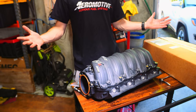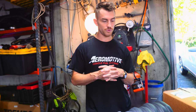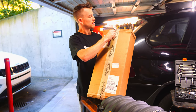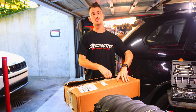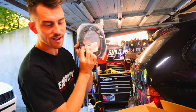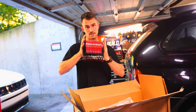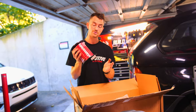I went ahead and went with the FAST mid-length high-horsepower intake runners. We're going to place this over, and when we're done we're going to put some RTV to seal the corners, and then we're going to have a nice 102mm open-mouth intake manifold. The reason we went with the FAST over the Holley is we wanted to keep that same low hood clearance so we don't have to cut a hole in the center of our hood.